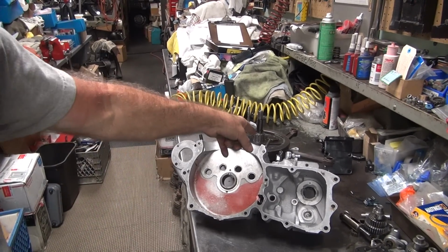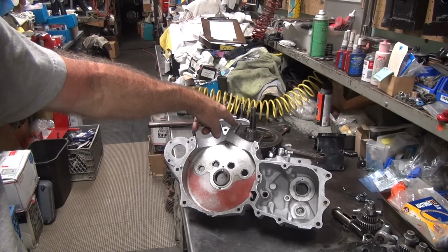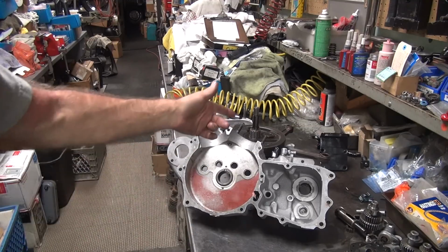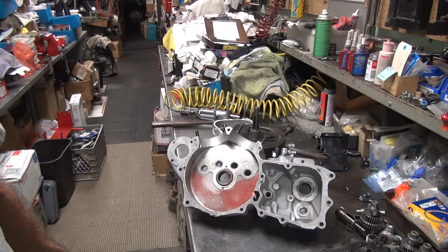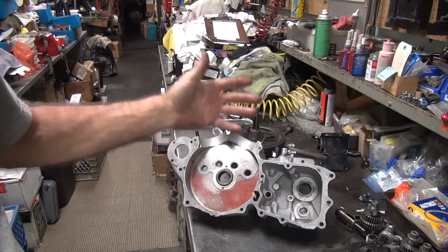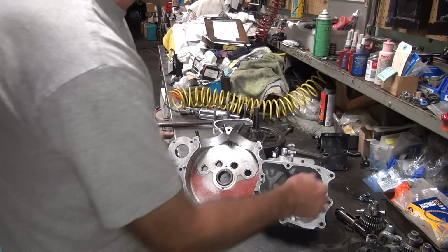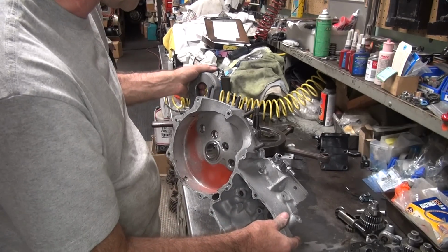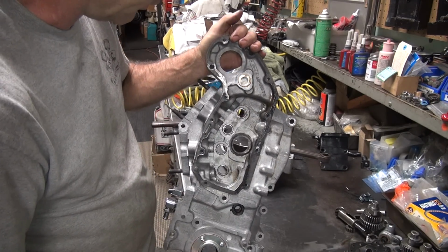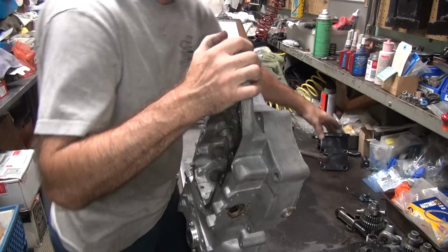I would never put a set of filthy wheels like that in the motor. I always blast them clean. That's all full of old burnt on carbon and crud. Who knows what's inside of that grit, that coating that's on there. You never know. A good oil will cut that off eventually. Whatever's being encapsulated in that will come out and go in your whole motor. Junk. You always want to clean stuff up like that. Okay, so not good. More issues.